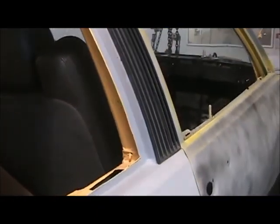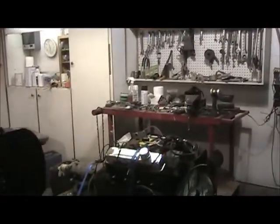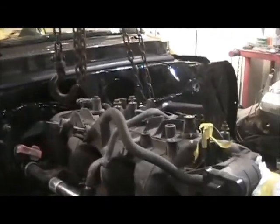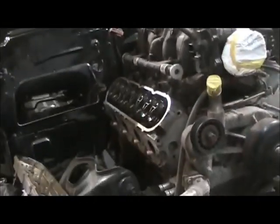But I had some help yesterday from 9 o'clock until 12:30. Buddy of mine came in and we took the whole complete front end apart off the Nova. We took out the motor and we set this one in. So she's just sitting in there. I wanted to find out just where I stood with this, how it was going to fit. Right off the bat, I got a problem. I gotta go find an oil pan, probably off the car engine. I'm not getting the clearance I need.